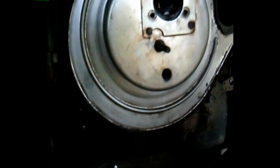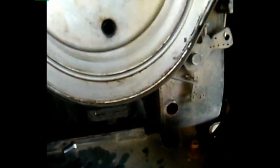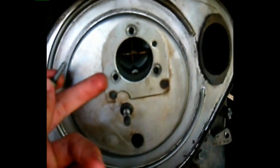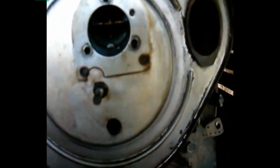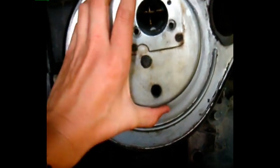After you've got these three bolts off, it's good to put them in an orientation so you know which one goes where. In this application these are all the same thread size, but if there's a different size bolt on some things, you want to keep them separate because you can strip the threads and it's totally screwed.